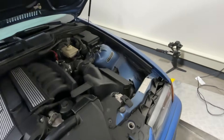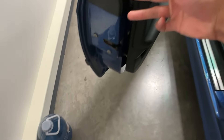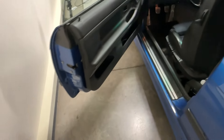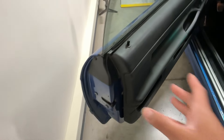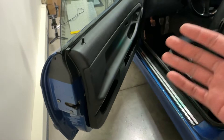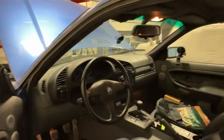The E36 is not known for its incredible interior quality. Running along the top of the door is a plastic tab that breaks down over time — your doors don't clip in from the top, and then they won't clip in from the bottom and sides either. Most E36s will have this problem. The headliner is definitely going to be failing — the glue is terrible from factory. Mine is basically peeling completely and is stapled right now, so I'm going to have to overhaul that.